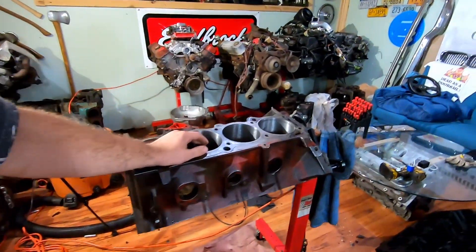I think it will put us on the right path. We'll get a hold of TA Performance and see what they think. Like I said, $500 for a set of pistons — we'll see what the connecting rods cost. The pistons came with wrist pins so I'll give them a call. They'll be forged, they're lighter, it'll make the engine a lot more responsive as far as RPMs, and quite honestly it'll make it a lot stronger.